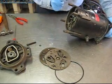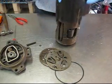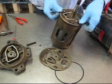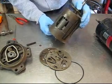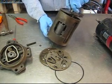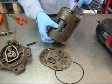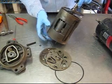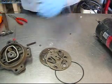Next is the cartridge to get out — the easiest way is to simply dump it out. This is the main piston assembly with a large set of reed valves on top. You can tell it's pretty dark and bad. This compressor does have a broken piston, but we're just using it for the sake of the video. Do not clean this; you can check it and make sure the pistons are not excessively worn — they should be relatively tight. If everything is clean, just set it aside for assembly later.